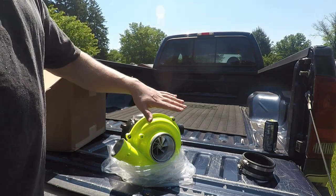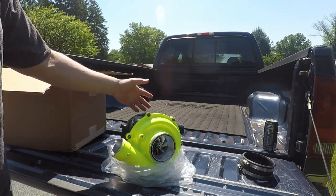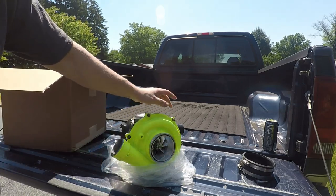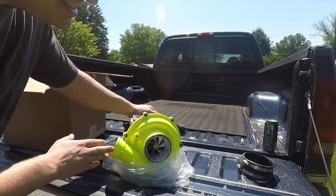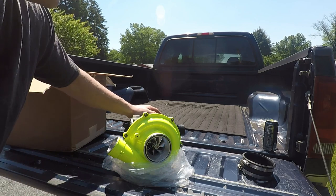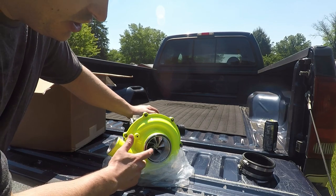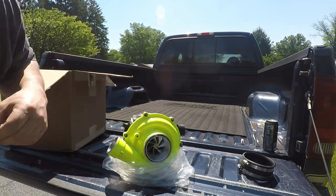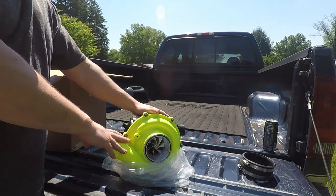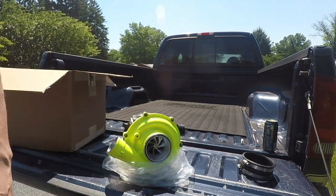Some things I want to point out about this. This is my original core turbo — they rebuilt the core, which probably didn't need anything, but I do have a new turbine wheel and compressor wheel because we went to a bigger size. So we did stick with the velocity port. It is a little smoother of a transition than the original one — the other one had kind of an exaggerated curve. We ended up going with the GXR7 turbo from the guys at Turbo Time USA.